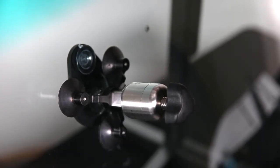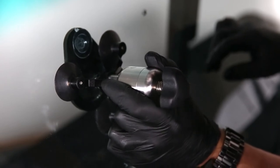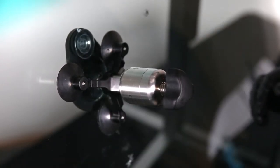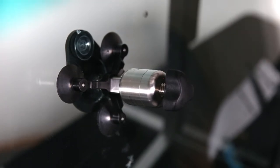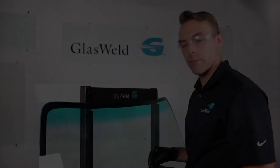To create the seal against the glass, click the injector in until the white seal contacts the glass, then do one to two more clicks to create a proper seal. If you feel you have to press hard for the second click, in all likelihood it's not necessary — you don't want to over-pressurize the injector against the glass, just press until it contacts the glass and you get one to two clicks.